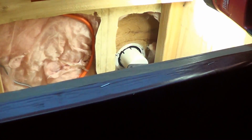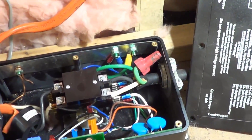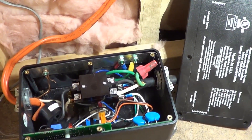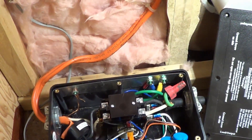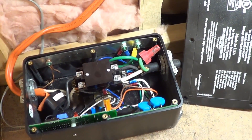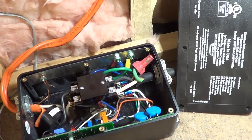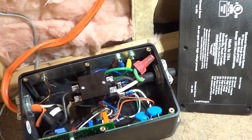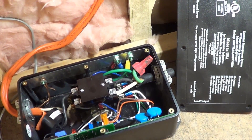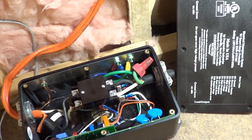I have my surge protector hardwired into the rig. You can see there's a big relay there — the power comes in on the black wire, goes through that black square relay, and out the orange wire. That goes to the main power distribution panel in the RV for the AC. What this thing does is before the relay closes it looks at the incoming power's voltage, and it will only close the relay if it's good. It senses any miswiring in the campground power pedestal. If the voltage is too high or too low it automatically shuts down to protect the RV circuitry.